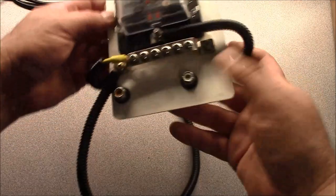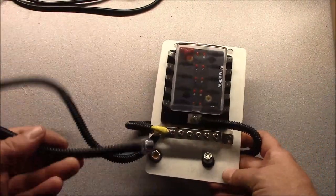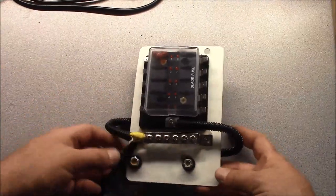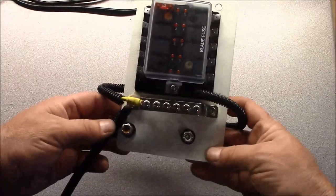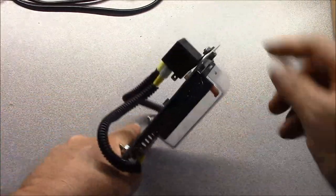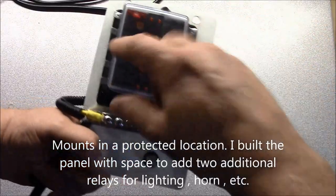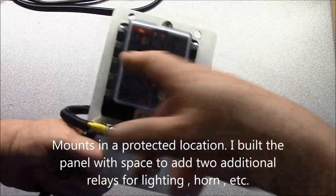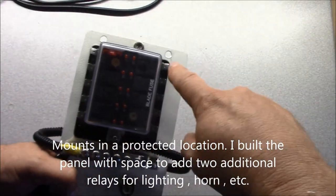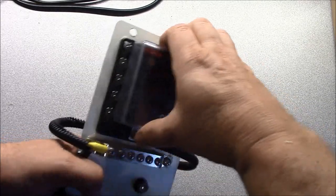This is the DC distribution panel I built. There's a ground lead going to the chassis next to the battery box, and two quarter-inch bolts to mount it inside the cowling. On the back side I have the master relay — a 30 amp relay — and a 10 gang fuse box. I can run the ignition on one circuit, add lights on another, add a voltmeter, and still have seven additional circuits to use.